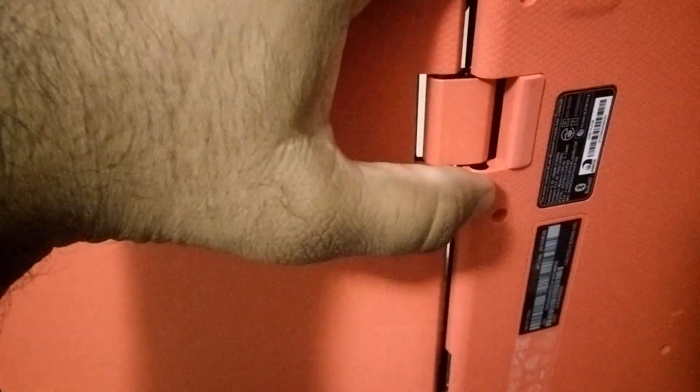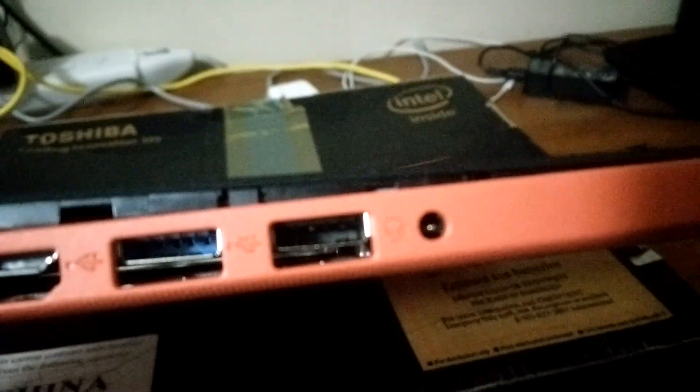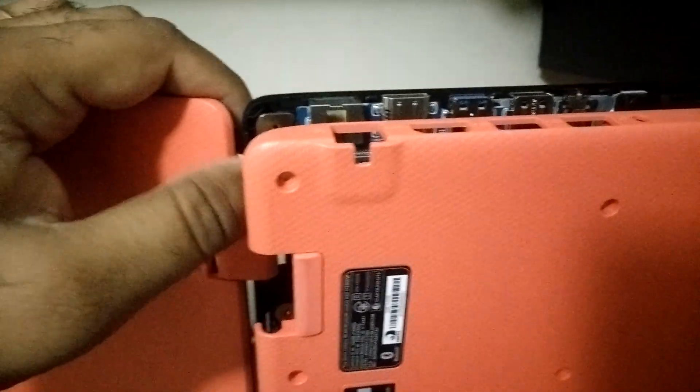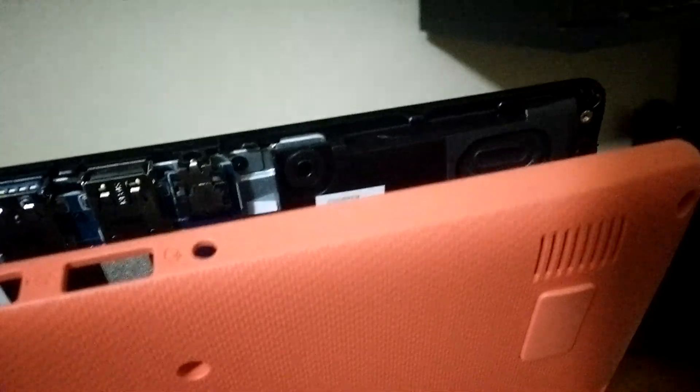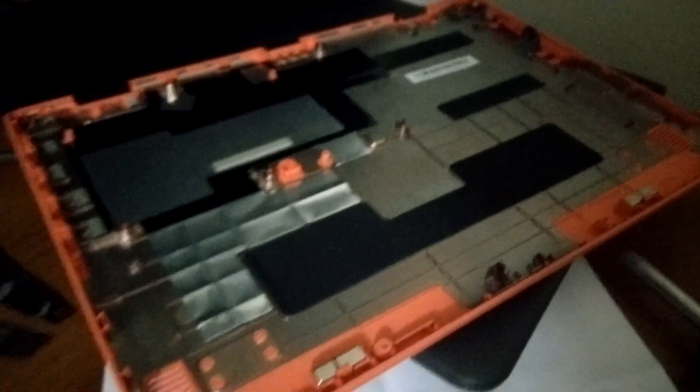Right after the point where I was holding the laptop it was open up to there. I started opening from there and had to snap a little bit to open up to the earphone jack area. I put my fingers gently between the motherboard and the back cover and pressed outward — it's about half open, and I still need to do the other side.